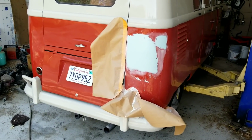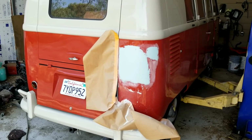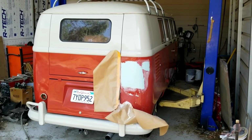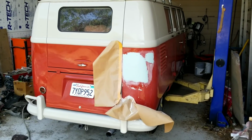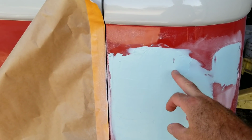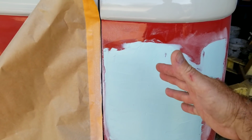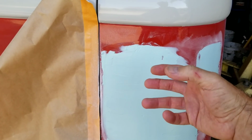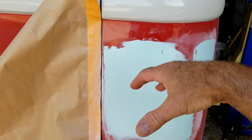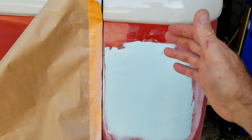On this camper, they're trying to get the photo shoot set up for this bus. We're trying to get a time together, and I had some damage on this corner. What happened here is the paint was chipping away, because underneath is where I did body work when I was building this bus. I guess the master cylinder reservoir was leaking, and it leaked the brake fluid out. I was backing it up and I stepped on the brake pedal and it went to the floor, and I grabbed the e-brake.